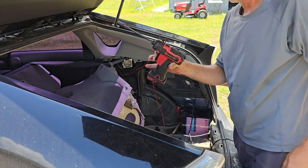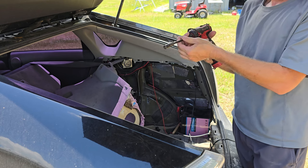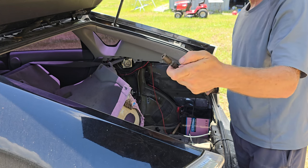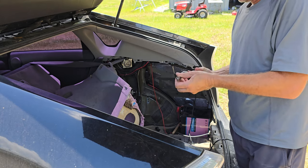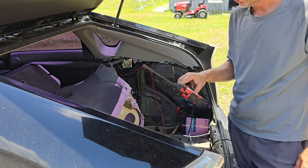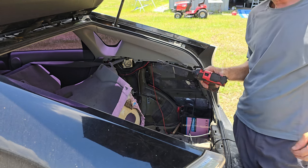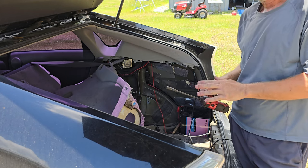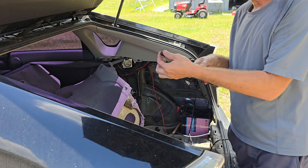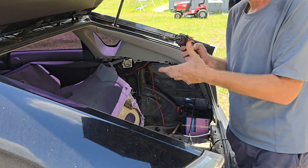That's why I have some of these tools that I do, like this Snap-on drill, forward and backwards all at once. You don't have to press any buttons. It's got a quick detach, and that's why this is the way it is. So this is a 10 mil socket, a quick detach extension, and it's magnetic. When you're working inside of a car, inside dashboards and stuff like that, and getting screws out, these are absolutely necessary. I have small ones too, little extensions that all have their own different socket on there. I have a 5.5, a 7, an 8, a 1/4 inch, a 10 mil, all the different sizes. So instead of having a bunch of little sockets rolling around, easy to lose, they're on their own extensions. I just unplug it, plug the new one back in, ready to go to work.